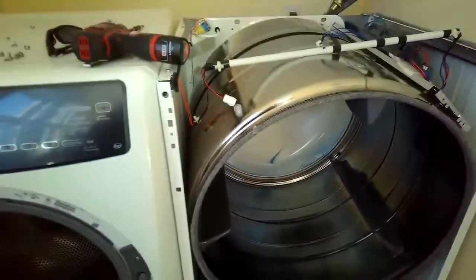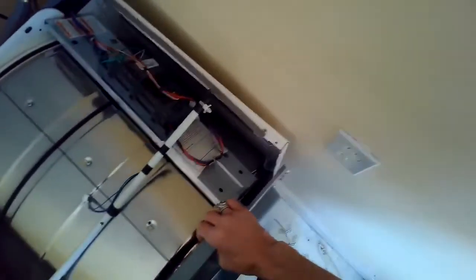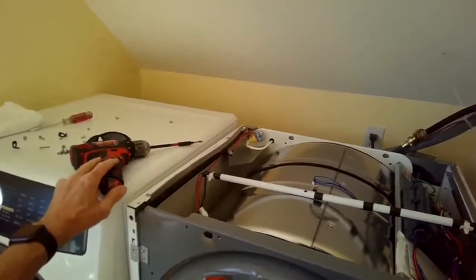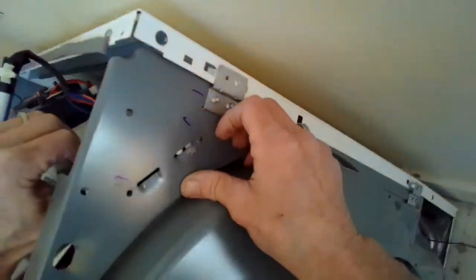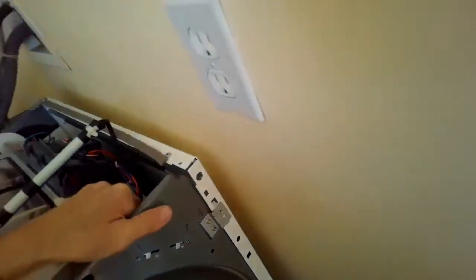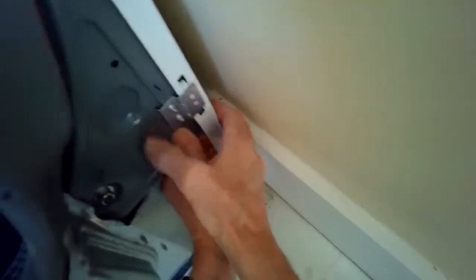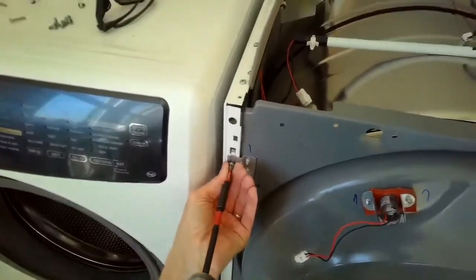It's a lot of disassembly but it'll get your dryer working great and get rid of the noise. I'm putting the bulkhead back into position, getting the wheels underneath the tumbler, and lining up the four sides — the bulkhead has little tabs that line up to grooves in the frame. Once those are lined up, I can put the controller support bracket back in, making sure everything is correctly supported.